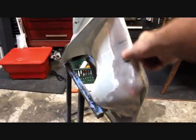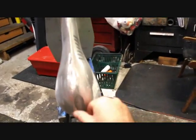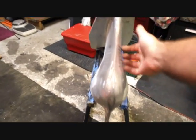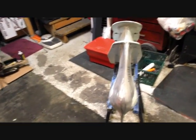Along with our filling, we fill it around with our 8-pound foam, which is hard as a rock now - you can't even chisel it out with a screwdriver. We also use our disc wire wheel to knock all the foam out of each one of these grooves, then we go ahead and fill it with JB Weld along with the bottom. There's also a drain hole out of the bottom here. The main reason we put the foam in there is just to not let any water inside so it doesn't ice and then bust these pieces out - and that's the culprit of most nose cone failures.